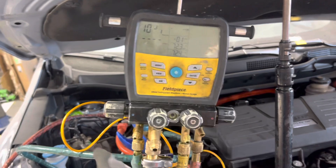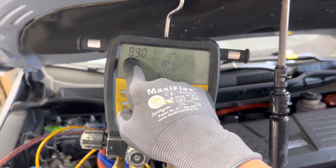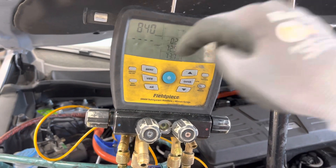And you can see just within that short period we're already down to 900 microns. I'm going to jump off and do the paperwork on this, and then we'll come back when I fill it up.